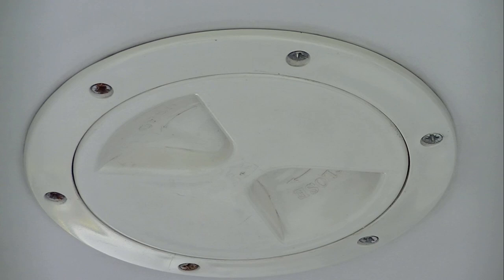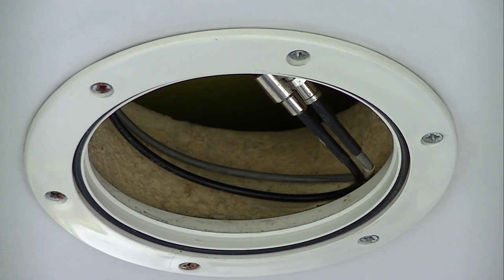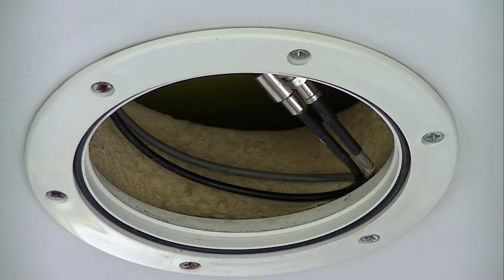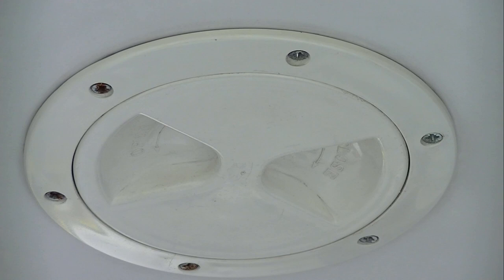These access ports — they're brilliant little things. This is an access port for one of the three sets of aerials on the roof. But again, you can see the insulation only goes so far — three-inch void, water droplets up there. That's only a thin piece of plastic and heat's going to go through that. Any warm air that's got moisture in it is going to condense on the metalwork. This is effectively the plastic skin here, and these covers are effectively a vapour barrier.